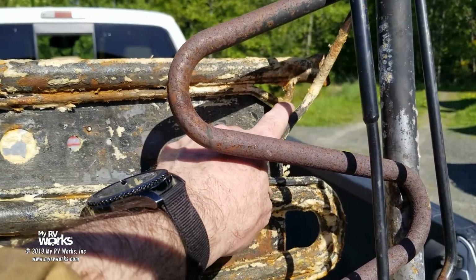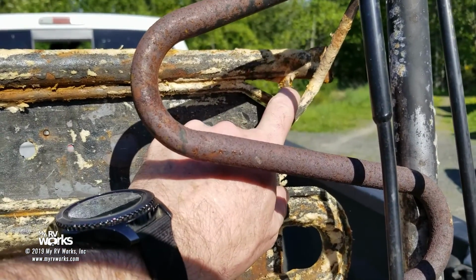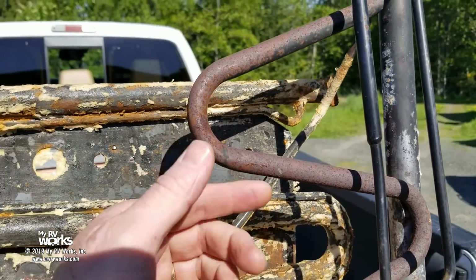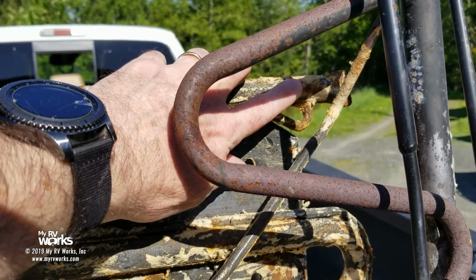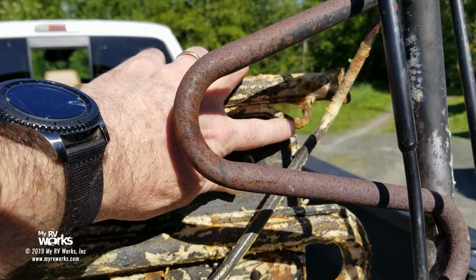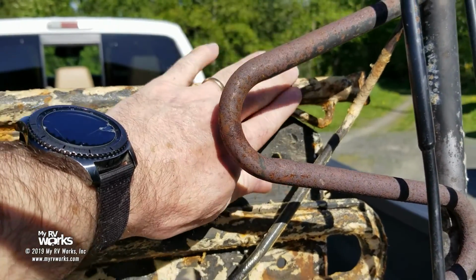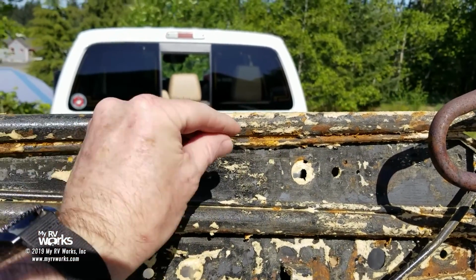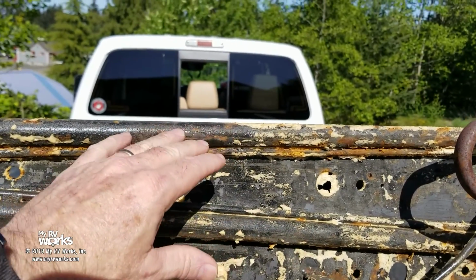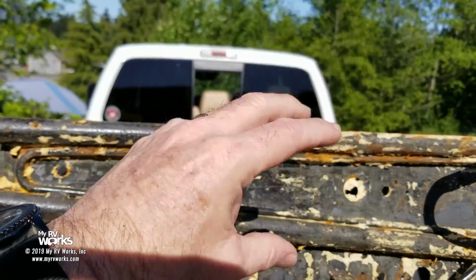And so that's kind of what's going on in here. This is under pressure, and it goes into a larger space. Like on our pressure cooker, we released that little lever and all the steam came out. So it went from high pressure to low pressure. So there's a pressure drop right here. And when we go from high pressure to low pressure, that's where the steam happens, okay? So in this larger tube, the ammonia is vaporizing rapidly. The hydrogen and the ammonia just rapidly vaporize.